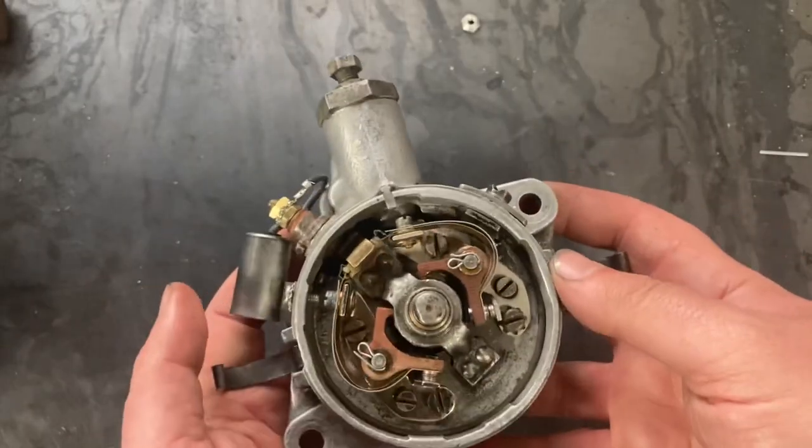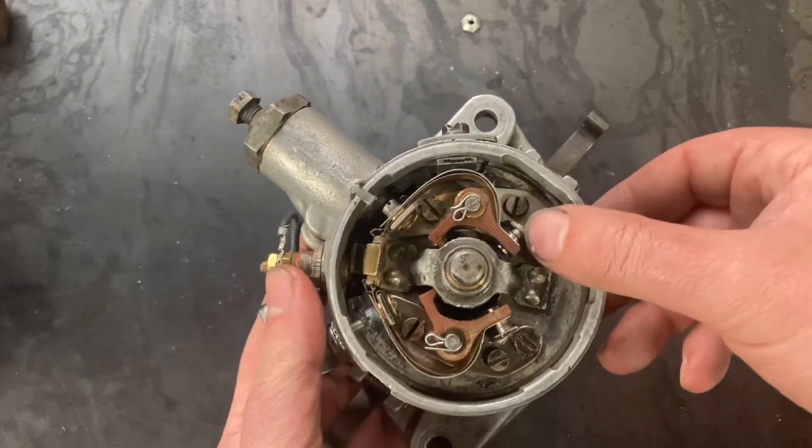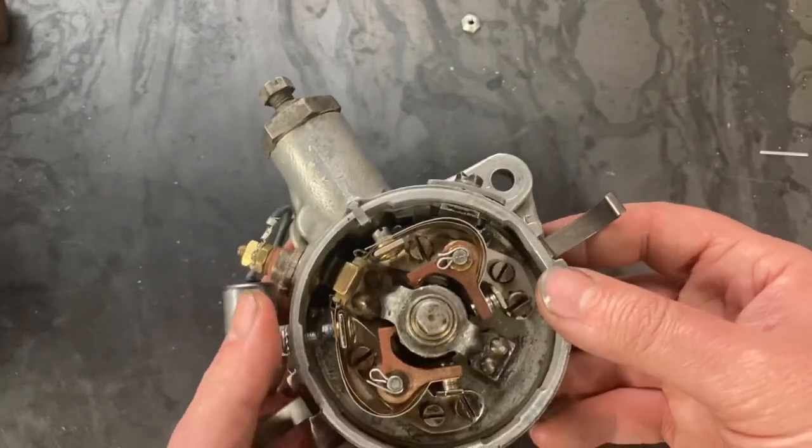All right, so that's pretty much it in terms of the rebuild. The next steps are to set the point gap and the initial advance. We're going to save that for the next video.